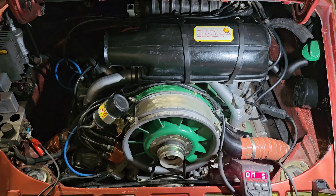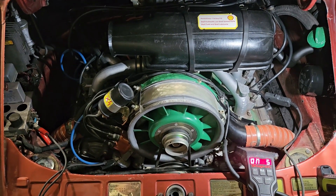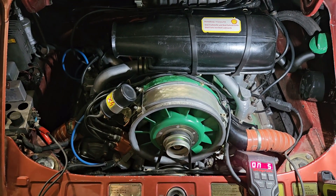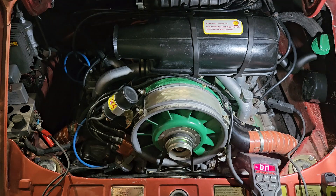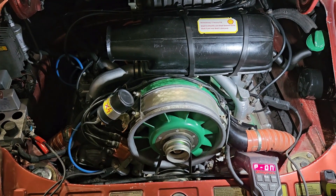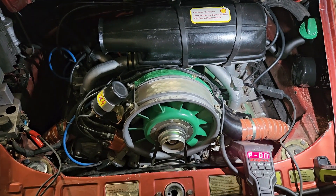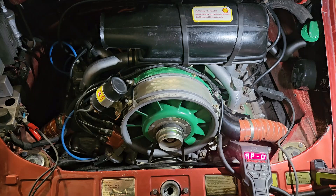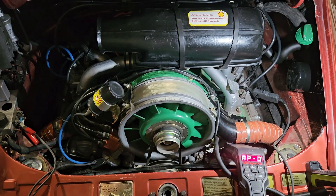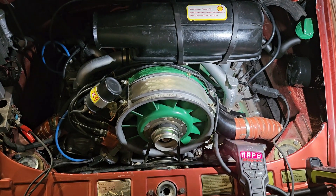This is actually measuring at the same spot that the pressure sensor for the gauge sees, but it is not actually the best. The best place to measure actual oil pressure is at the back of the motor where the oil safety switch — often called the idiot light — is installed. The idiot light is set normally at 0.8 of a bar, so oil pressure is going to be somewhere around 10 PSI or lower for it to turn on.